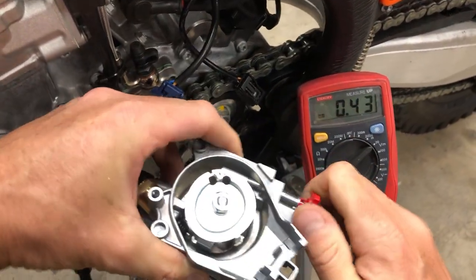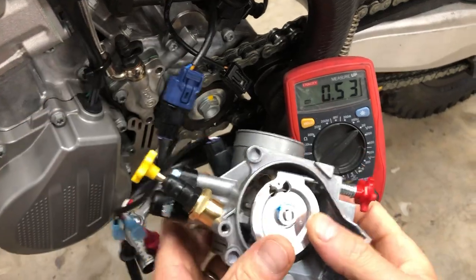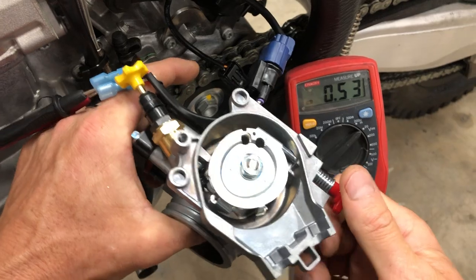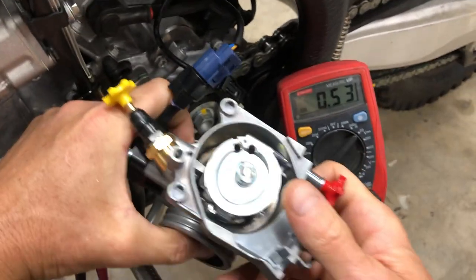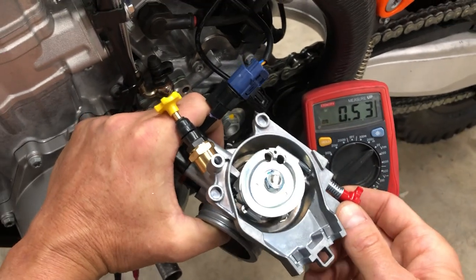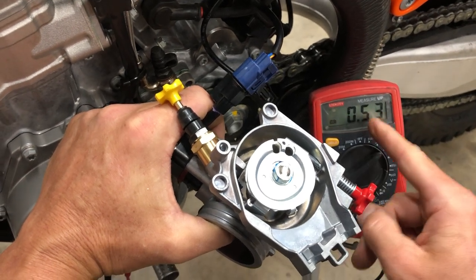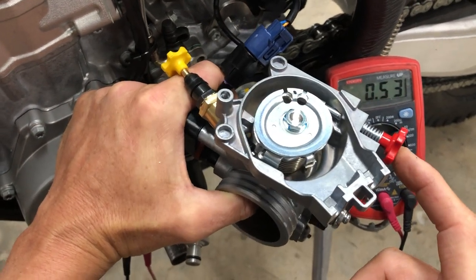So if I turn this back up to 53, this bike should basically, ideally, start and run at 53, 54, 52, 55, somewhere around there. And that number will change based on wherever the idle speed is. So if you read in a forum, a keyboard warrior will say, what's the stock value? And he'll say 53, 52, 54, which is kind of accurate, because most bikes, and again, air quotes, most bikes running at 1800 or 1900 RPM come out to be about 53, but not always. And there's variables. So that's not the true zero mark. 53 with the idle speed knob influencing the number is not the true base number.